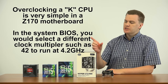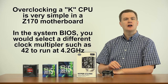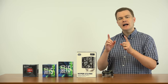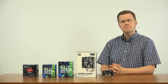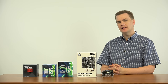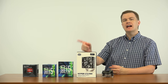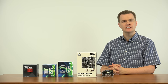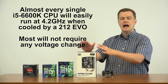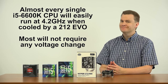If you want to overclock and you've installed it in a Z170 motherboard, it's very easy — by changing the multiplier of the base clock speed, for example from 3.5 to 4.2, boom, you're running at 4.2 GHz. At anything up to 4 GHz I actually don't have a problem with the stock heatsink, but for more overclocking you generally get better results with something like the Hyper 212 EVO. For an i5-6600K, the Hyper 212 EVO is an excellent choice — 95-plus percent of i5 chips will comfortably run at 4.2 GHz on it, and the $30 cooler shouldn't break the bank alongside the $230 chip.